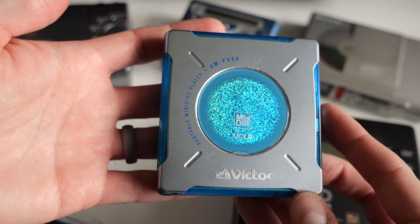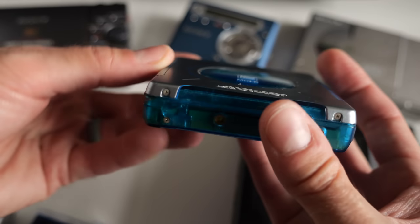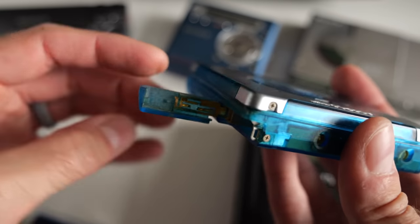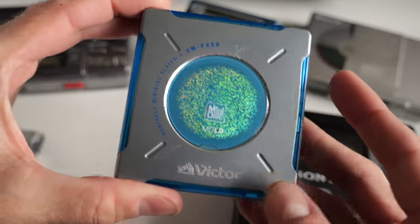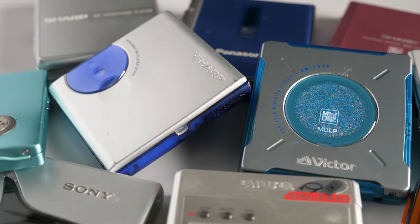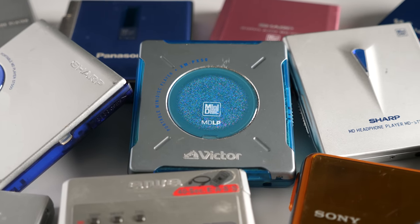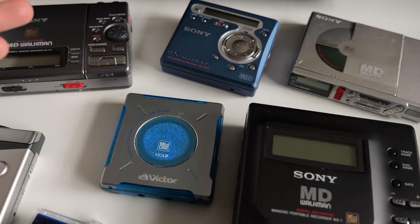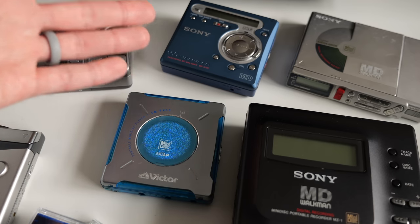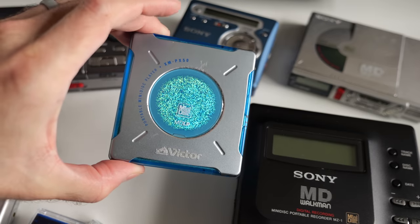The big problem with pretty much any portable recorder or player is battery leakage, and the portable ones with the gumstick batteries are unfortunately no exception. Even though they're rechargeable, the gumsticks can still leak if left in for a long period of time. Sometimes that's something you can fix, and other times the leakage gets so far into the internals that it's pretty much unsalvageable. I bought a whole bunch of portable players in a big lot from Japan, and only a couple of them were ones I was able to fix. That said, if you really want to get into it, you could buy a lot of unknown-condition portable players imported from Japan — that's the country where Minidisc was most popular — and try your hand at fixing them.